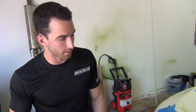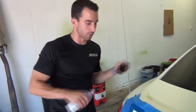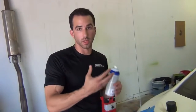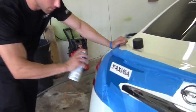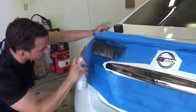Now we've got everything masked off in the back, and we're going to apply the Plasti Dip from about a seven or eight inch distance. One of the most important things is to keep that distance consistent — don't go in and then come out on it, and always keep the can moving. If you keep it in the same spot it's going to build up and get too thick. So follow a nice brisk streaking motion and work your way down on the emblem.